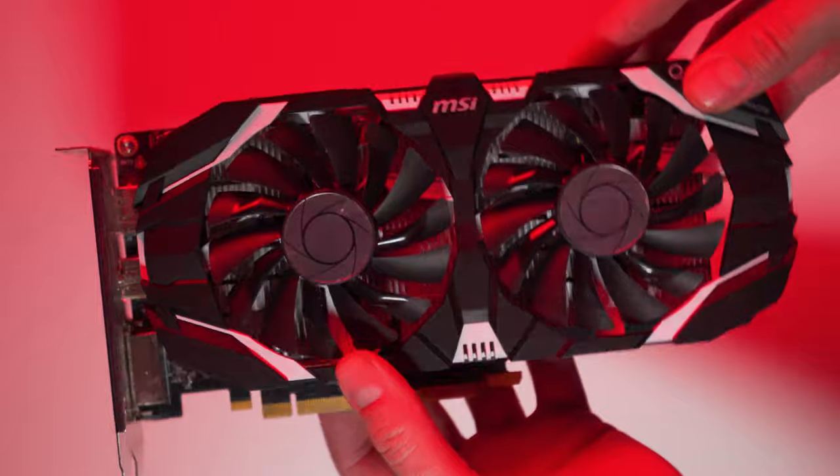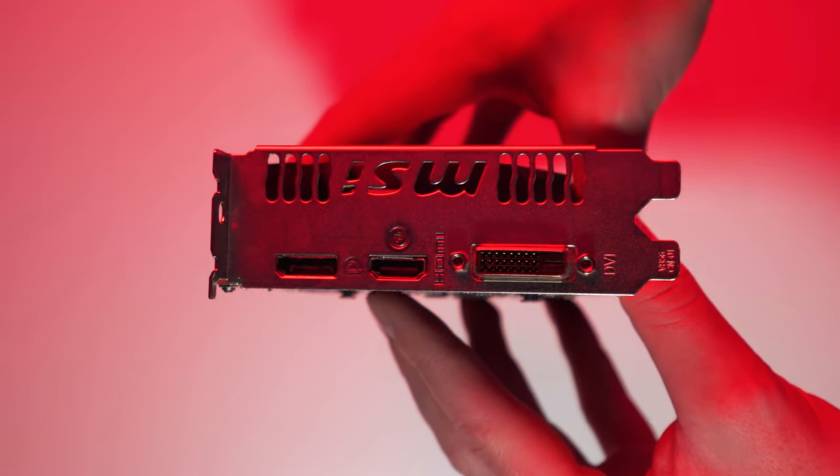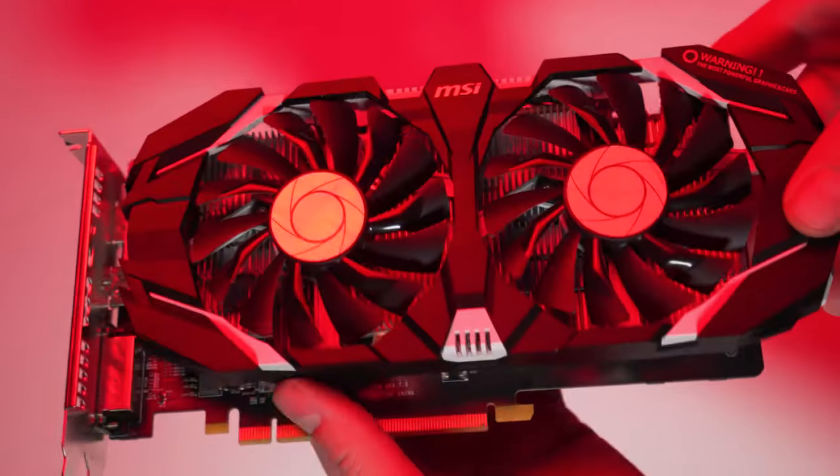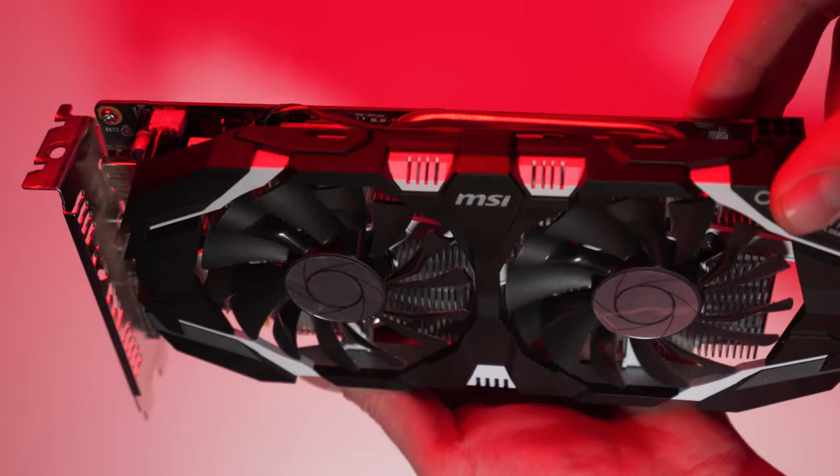For the GPU, we could have gone a little more crazy, but to push frame rates to very respectable numbers while playing it safe with our stock 475-watt power supply, we went with the GTX 1060 6 gigabyte. This card is still very respectable for 1080p gaming, and I found this specific one for $120 on the used market, which I felt was an awesome deal for a budget build like this.